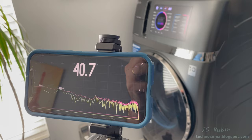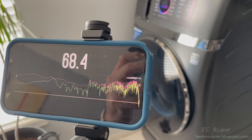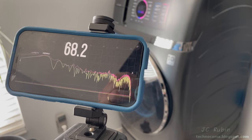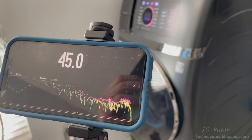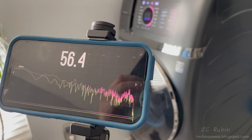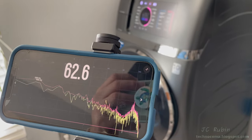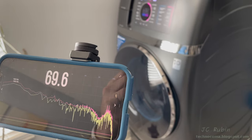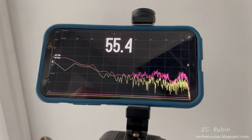A quick look at noise from about five feet away: for most of the wash cycle it sits at around 50 decibels. Intervals where water fills into the unit bring it up to around 68 decibels. The highest speed of the spin cycle is around 70 decibels. The spin just before the wash portion finishes sits at around 60 decibels. The dryer portion starts up at around 45, then slowly ramps up to just below 60, and later another portion ramps it to around 70 decibels for the duration. Through a thin closed door, that 70 decibels drops down to a respectable 55.